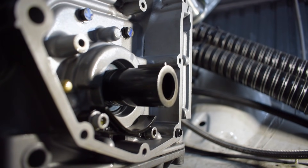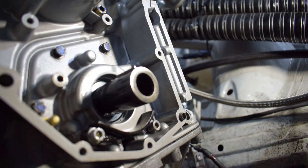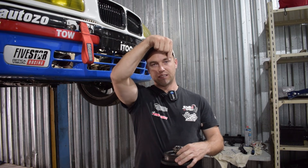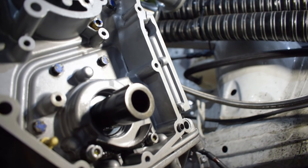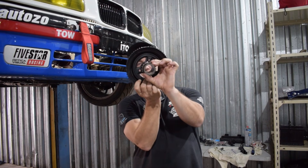What we did is we extended the keyway and made the key one long key instead of having two keys. We machined down in the existing keyway and just extended it, then made up one long key that slotted into the crank, covering both the sprocket and the balancer simultaneously. This way you don't have two keys, only one key, and you don't need a super fancy cutter to cut a second woodruff key. It's also better to have a square elongated key so you know exactly that they are both lined up and there's less risk of losing a key.